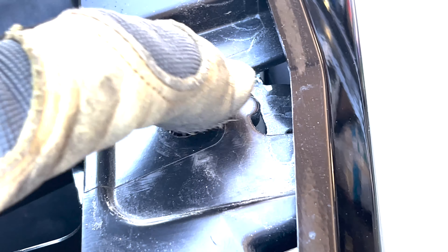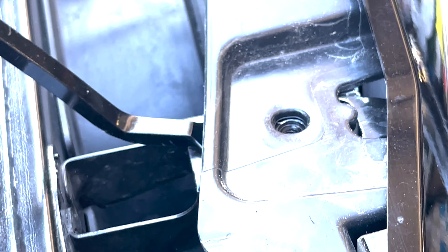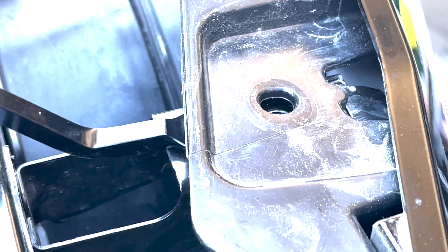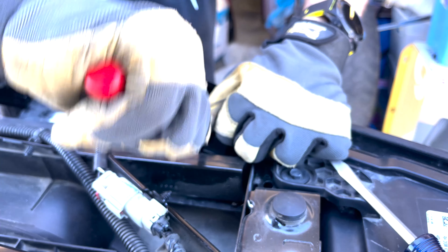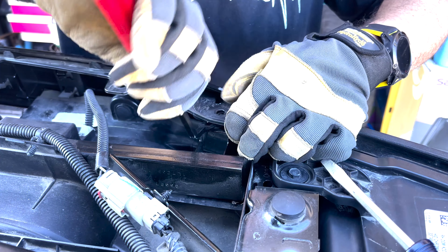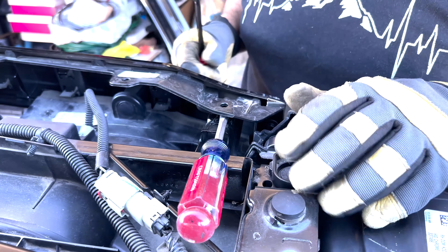It's important to address the two ends of the top of the grille that have these plastic tabs where they clip into the metal frame. They're kind of seated in there — you can use a flathead screwdriver. The angle on the same tool I used to pop the plastic rivets actually works pretty well too. You just have to pull back and pull out, so you need two hands. Just lift up and then pull forward and you'll get it unseated. It will spring back in, so it's probably a good idea to leave something in there — like a screwdriver — so it doesn't seat itself back.